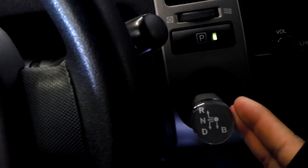When you're in this position, what you want to do is hit the accelerator pedal twice — one, two. Then put the car into neutral, which you can do by holding the brake and holding in neutral. You can see now the car is in neutral.